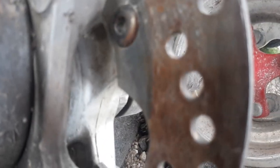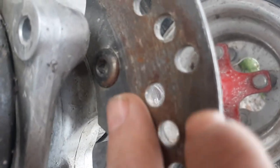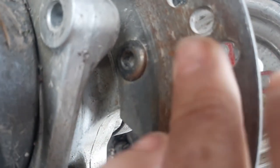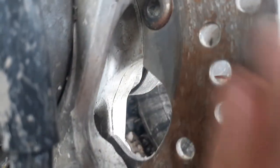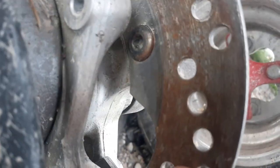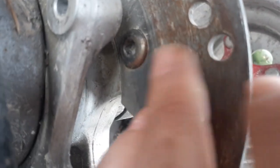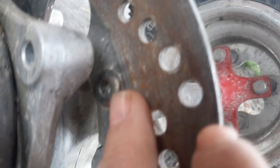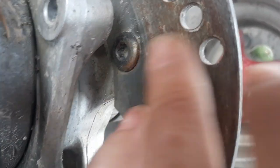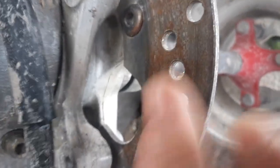These things go through rear brake pads like crazy, and I tore this disc up — it's got indentations in it. I put new brake pads on and the rear brakes wore out in like one day because it went through them so fast. The piston actually hit the disc and made it worse — I wore the brake pad right down to the caliper piston. So I bought a new caliper and I still need to get a new brake disc, and get that spacer problem fixed first.